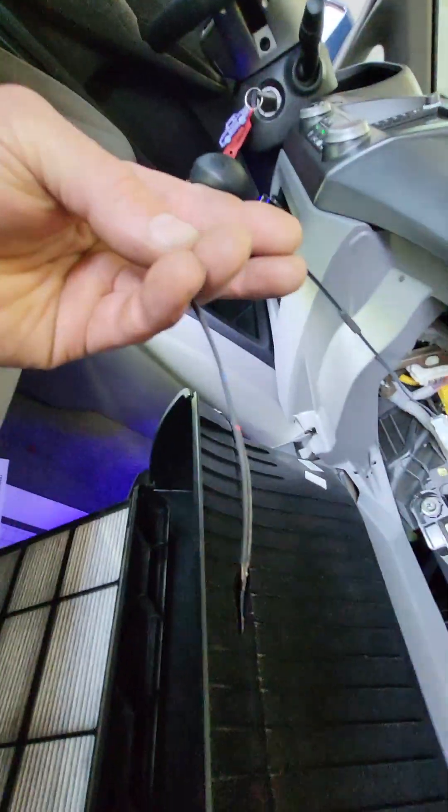So I'm thinking, do I have a bad compressor? This is a new part, it's not remanufactured. There's really no diagnostic strategies for the climate controller other than a bunch of manual checks. The expansion valve checked out good. So I'm in here with an ohm meter and I checked the evaporator temp sensor — it says it's open. There's no specified value in AllData to tell me what it's supposed to be, and it took a week for us to get an evaporator temp sensor.